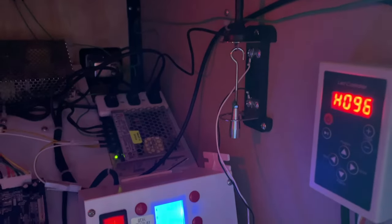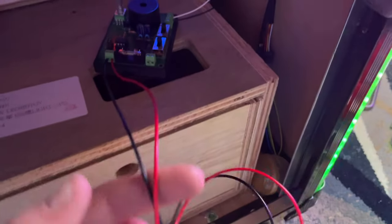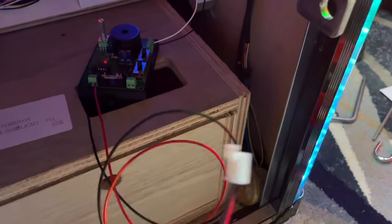I have connected the sense wires from the tilt sensor into the correct position on the board. The orientation of these two wires does not matter — you can connect them either way as long as they're in the correct header pin on the board. What I'll do now is route the wire with the correct connection over to the J2 pin.